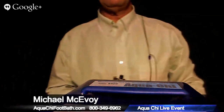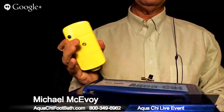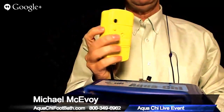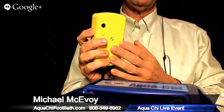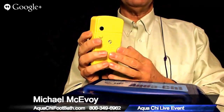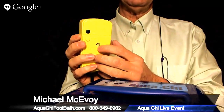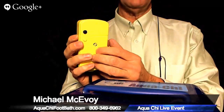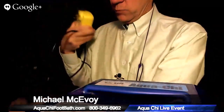Starting from where you plug in, of course, you're going to need to plug it into the wall. This is an older style wall plug that we use. Many of you have the yellow one. However, we do have a newer style that's smaller than this. It's black in color, but same exact performance. They each have a reset button. So if you plug in the wall and you don't see a light, automatically press the reset button, and that will turn on the light. You need to have that light on in order to have electrical current running to the machine.